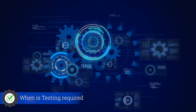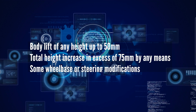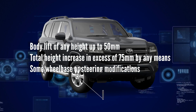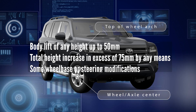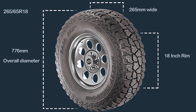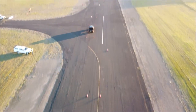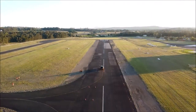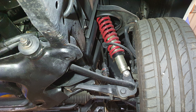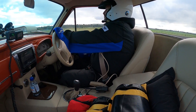When is the test required? In New South Wales, an LT2 swerve test is required when any body lift up to 50 mm is performed, or when a vehicle's total height exceeds 75 mm higher than its original height — this also includes the tyres. So a 50 mm suspension lift and a 50 mm larger tyre will increase the vehicle's total height by 75 mm in total. It may also be required at the discretion of the certifier for some extended wheelbase and steering design change modifications, to confirm the vehicle can still operate as original.